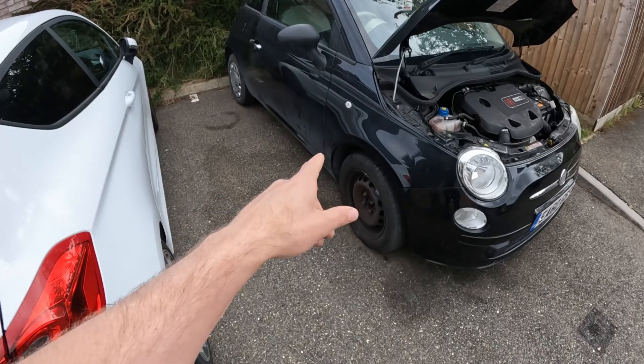The exhaust is definitely noisier than the old one that came off, so I'm wondering if where I connected the flexi from the exhaust into the bottom of the cat is clamped down and sealed enough. I just can't get in there. I think what I'm going to do is take this car for an MOT - even though it's got about six months left, after all this work I want to give it a clean bill of health. I'll get the garage to do the wheel alignment and check that exhaust joint while it's there.